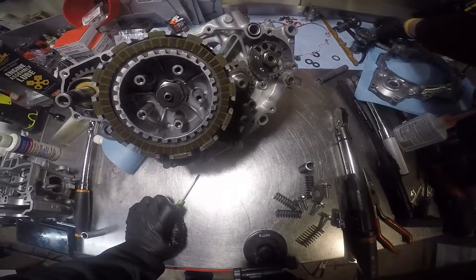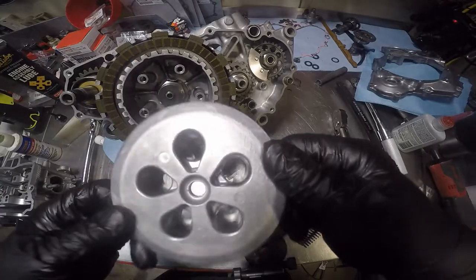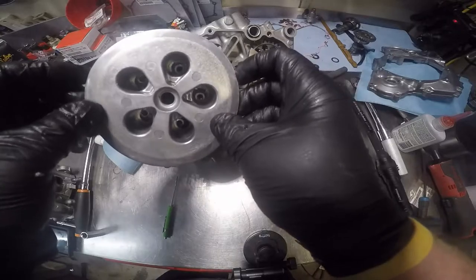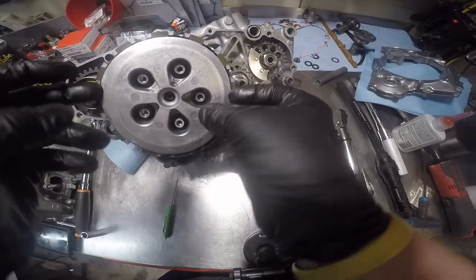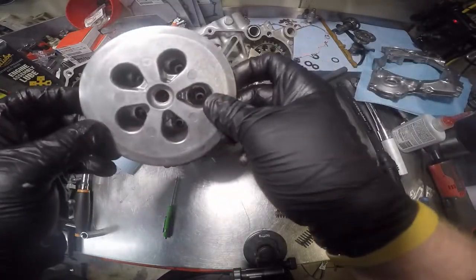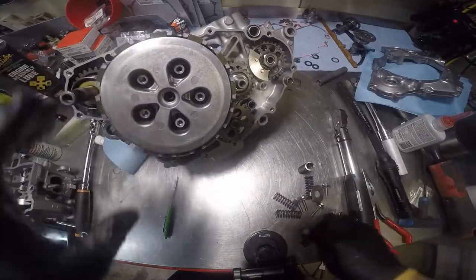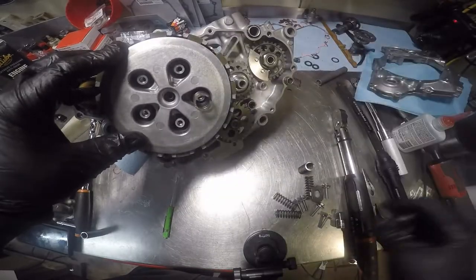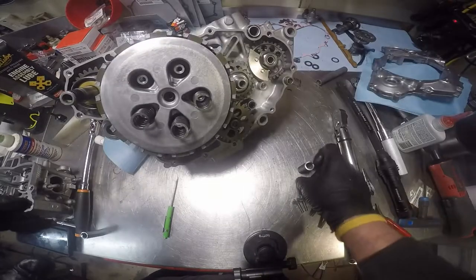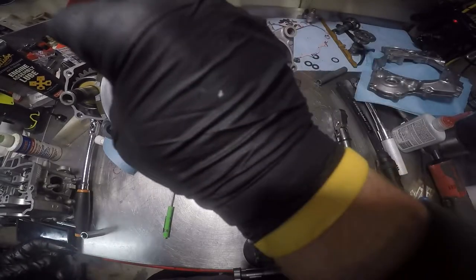Now, we're going to take the outer clutch hub. Set it. Now, make sure these teeth here go down in the teeth there. Sometimes they'll sit on top, like that, and then it won't. You gotta make sure it goes down. Otherwise you torque the bolts down, and you get on it and crank it up, it'll run, but it won't go nowhere. The clutch just free spins.